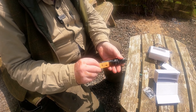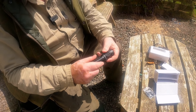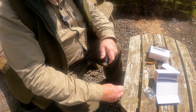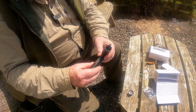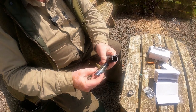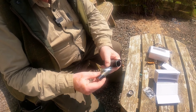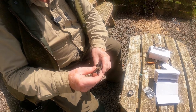When it comes, it's got one of these warning stickers on. Basically what that means is the torch can't work because there's a bit of cardboard in there. So you just unscrew the back end, lose the cardboard, shake it out, and there's the battery. It's a 21700 — that's bigger than the normal 18650 — and this one is 5000 milliamp-hours. That's quite a big battery, so we should get some good run time out of it.